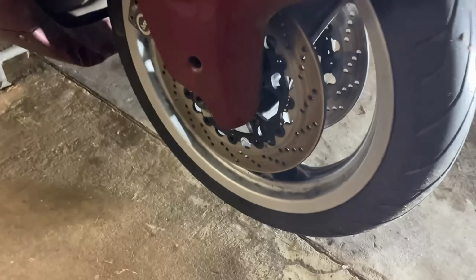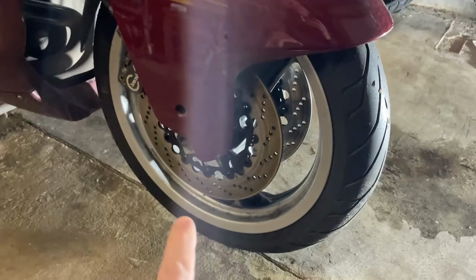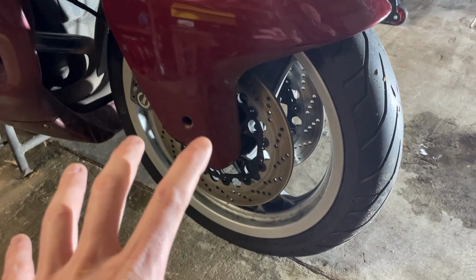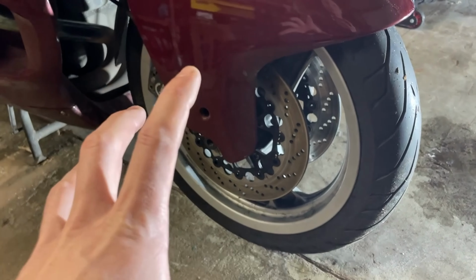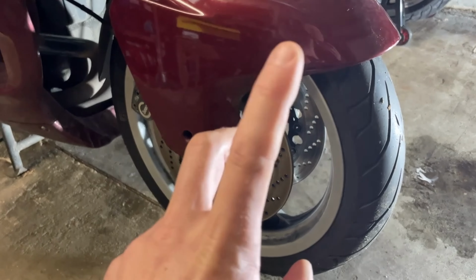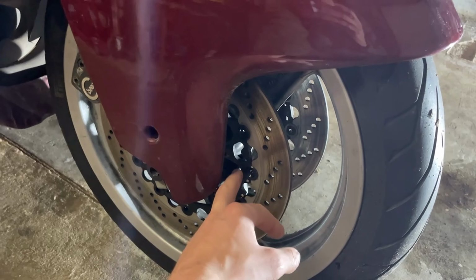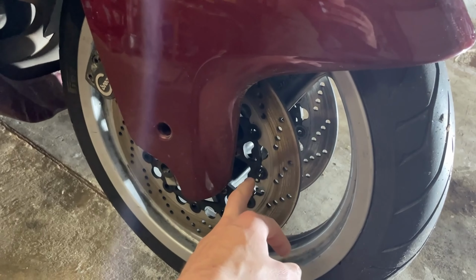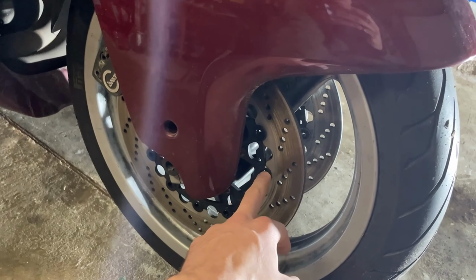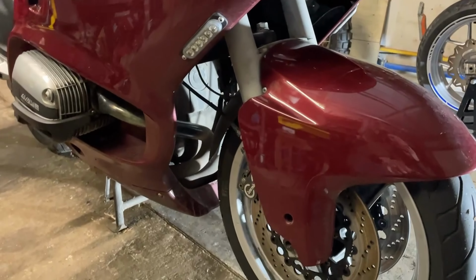So as you can see, it feels like this one is a bit better, but after 1200 kilometers, after doing the initial change and the initial test, which was actually a solid pack, we're back where we started. I have trust in the bobbins that they won't break because they're new. But the whole discussion is, yeah, but your carrier, which is aluminium, and your rotor, which is tempered steel, are going to wear out as well. And in my case, I think this happened because this bike has been running a long time with this problem.